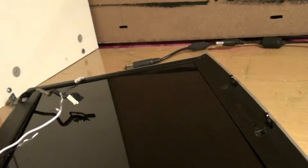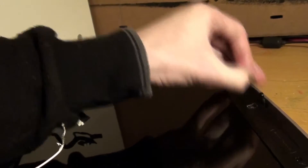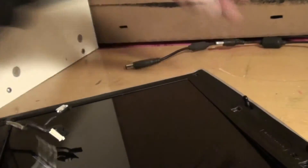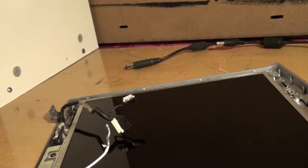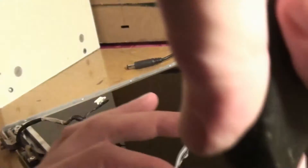This is the screen - hang on, I'm mixing it up with my other Dell. I had to take the screen out of the other Dell because it was similar. These screens are actually very similar - they use the same panels, just different inverters or different connectors for the motherboards. Trying to take it out and it won't come out. There's that locking thing. All right, there it is. The bezel is precious. I'm going to take the screws out and take this screen out along with the inverter so I can get to the wireless things underneath.